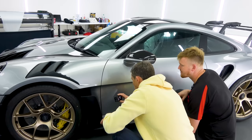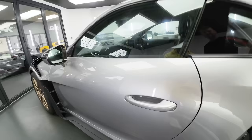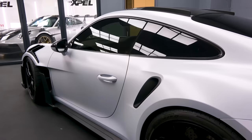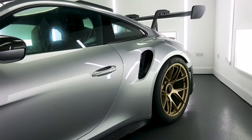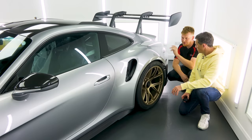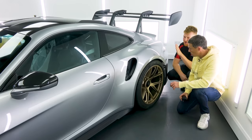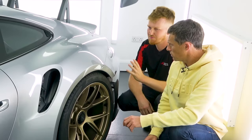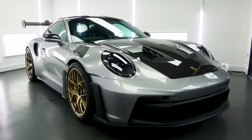Do you know why I think that is? These doors are carbon fibre so they're not pressed from metal, so they're harder to get bang on, but it doesn't look too bad. The other GT3 RS is a little bit wavy just the same as this one, so maybe it's just a Porsche design. What's the paint finish like in terms of orange peel? We have orange peel on most of the car - there are a few little bits that are slightly different, some of it being carbon fibre versus aluminium. The orange peel is nothing to worry about on this vehicle. Carbon fibre is hand painted, so there's less orange peel where it's been done by hand than by the machine.